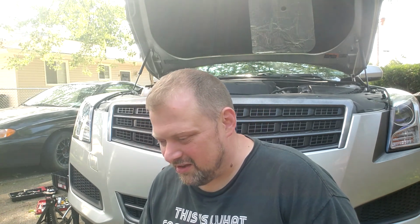And I don't get the thing so much anymore about the traction control, but now I kind of have a problem where it's progressively wanting to stall more and more at idle. And it's gotten to the point that I'll be driving and just about any time I come to a light, it seems like it's going to stall out. So that's where we are today, and I'm going to be replacing the crankshaft position sensor.